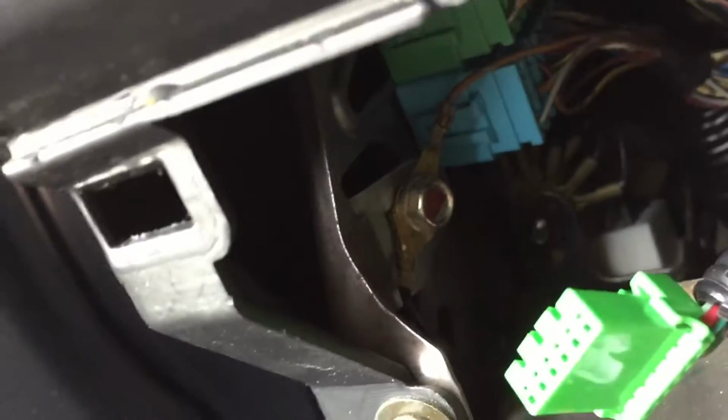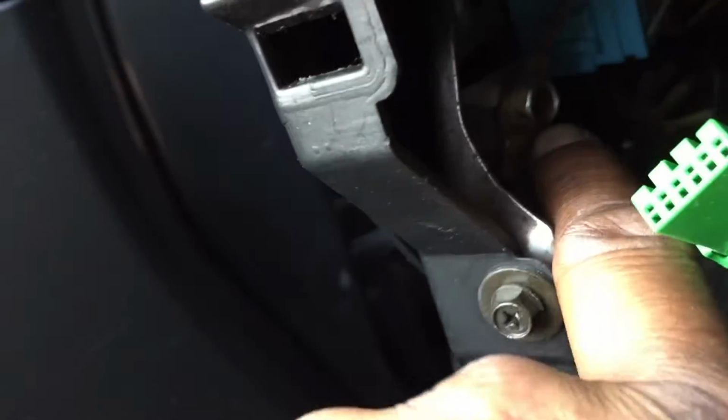And then this one right next to it with the red stripe is 12 volts accessory and on. So that's the other wire. The second wire is soldered. Time to tape everything up and ground it. I grounded the harness right here. Makes sense. There's another ground there. Now all I gotta do is plug in the switch.